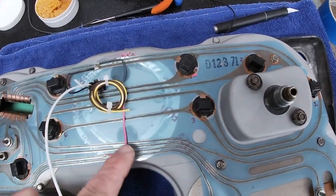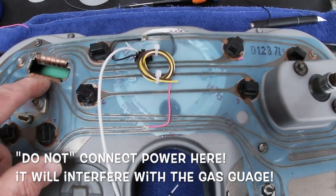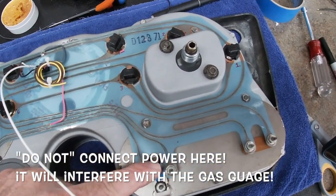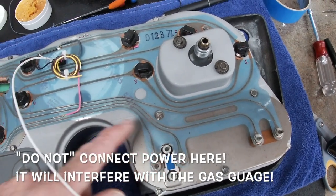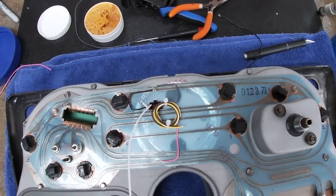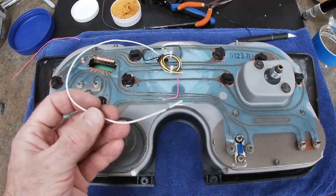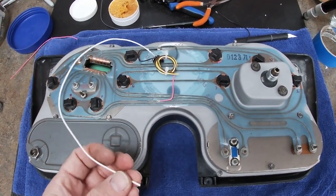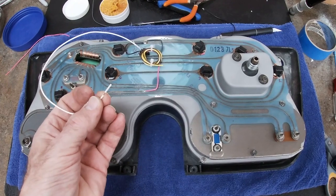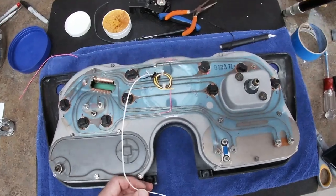And then the pink comes out here, and this is ignition positive. That's the same ignition positive that runs the positive side of the fuel gauge. It also runs the positive side of the temp gauge down here and the two idiot lights over here. So it is all ready to go back into the truck. There's not much else to do at this point. I've got a wire under the dash already that I'll splice into. In fact, now that I'm thinking about it, I might just put on a weather pack connector on that now before I even get this to there. So otherwise, this is pretty much ready to go back